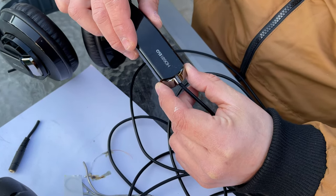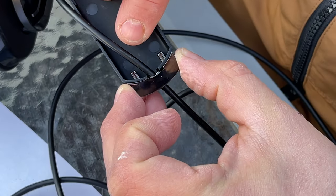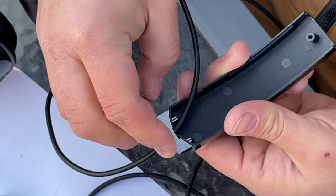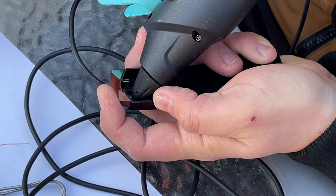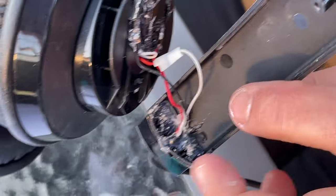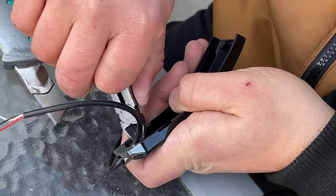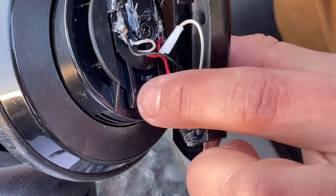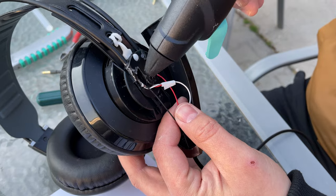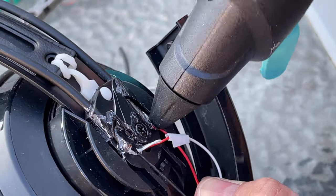The next step is to put the chrome part to the cover. We tried to apply some instant glue but it was really cold so it wasn't good enough to stick the two parts together, so you should use another kind of glue. We decided to use a hot glue gun, but don't put a lot of glue there because the cover should slide onto the headphone itself. We made a big mistake by putting too much glue and had to cut a lot of it off. Those two spiky things should go into the little holes, that's why you shouldn't put a lot of glue there. Also put a little bit of glue where the cables are connected so that the connection is really strong.